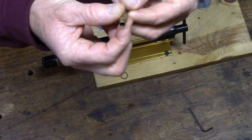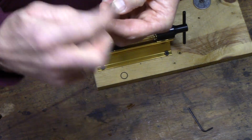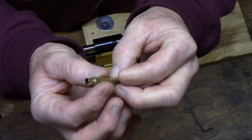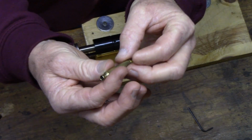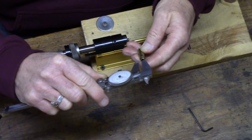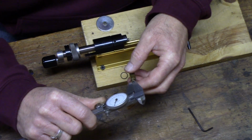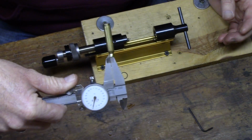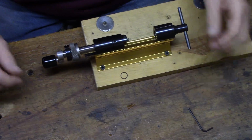Well, that ain't bad. I probably got 60% of that has been reamed off. The other 40% has not been touched. I don't know if you can see that very good or not, but our thin side is 10/1000ths on this one in particular, and we're 10/1000ths right there on the side we just shaved. That's pretty lucky when you do it on the first shot, huh?